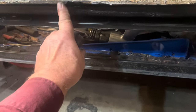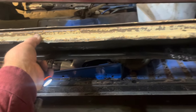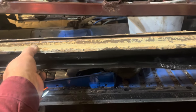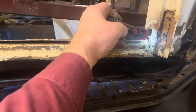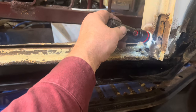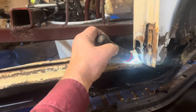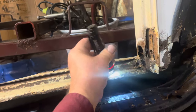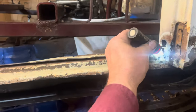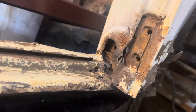I'm going to cut this piece right along this edge and that way it will butt right up against here. Once we get that tacked on and this tacked on together, I need to fit a door to make sure it opens and closes correctly. I can't do this piece until I fix this. I'm probably going to cut this piece of steel out and fold it over and weld it in, and try to patch those holes the best I can. There's a big build-up of weld where they hit it really hard right here — that's part of the support of the door, so I need to make that really good and strong. I also need the hole for the screw and the little plastic piece that goes in there.